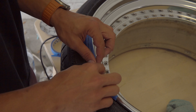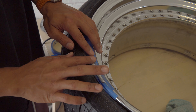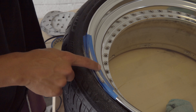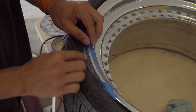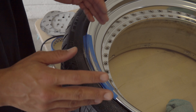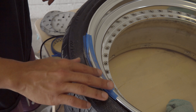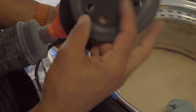The biggest thing when sanding is that you don't want to take off too much material. This is a curved edge, so you're not trying to make it flat — I'm working it across nice and easy, as evenly as I can. This was a big gash here so I don't want to take it down too much. If it's just a little indent there it's not that critical, at least for me. If you're a perfectionist you'll want to sand it down as perfect as possible or take it to a professional.